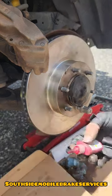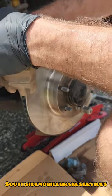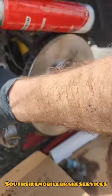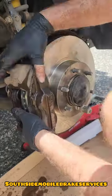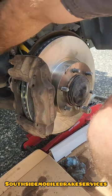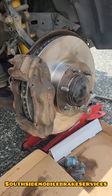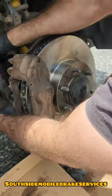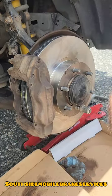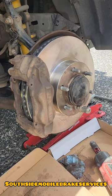For the caliper bolts, just put a tiny bit of loctite on them — it's just a bit of insurance to make sure nothing comes loose in the future. Before putting any power tools on, just make sure to turn the bolt in a few turns by hand. This saves you from cross-threading anything, and then you can send them home with the electric tools. Once you've done that, nip them up by hand to make sure they're all done up correctly.